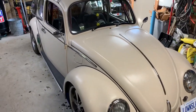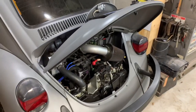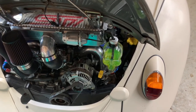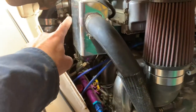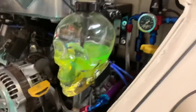This one here is actually an EJ22 — I have a few other videos of this Beetle on the dyno; it was dynoed at 301 wheel horsepower. It puts out a little extra heat than the naturally aspirated one, but it works great in this car running 17 pounds of boost. The engine in the other Beetle is an EJ22 turbo closed-deck block running EJ25D dual overhead cam heads. Same setup: modified crossover pipe up into an expansion tank, out to the front radiator, back down the other side to the water pump, and a little overflow bottle — this time I used a skull bottle.